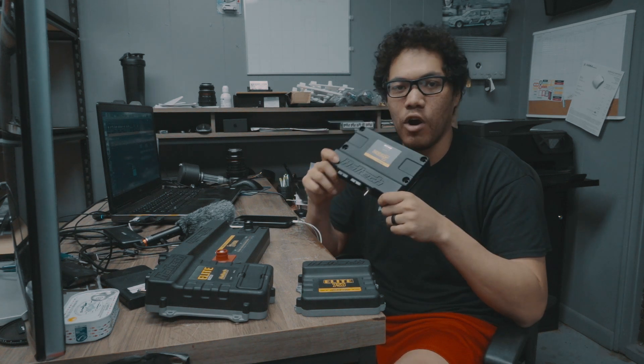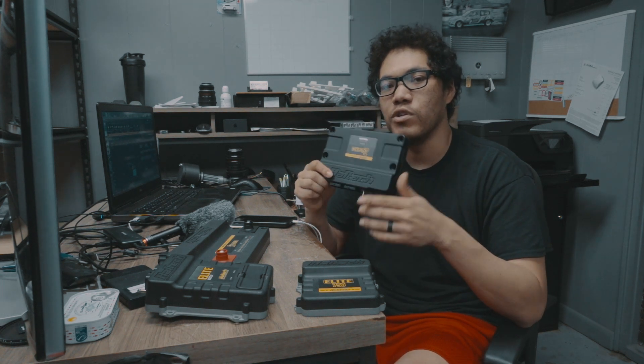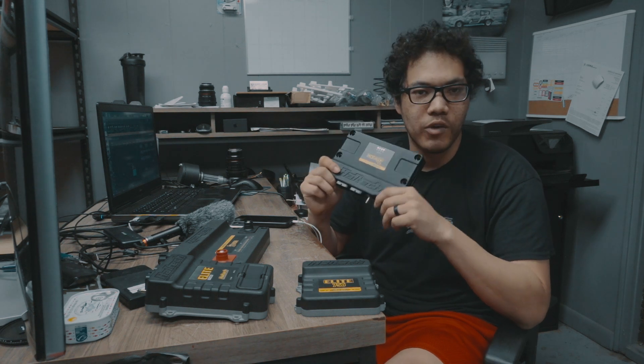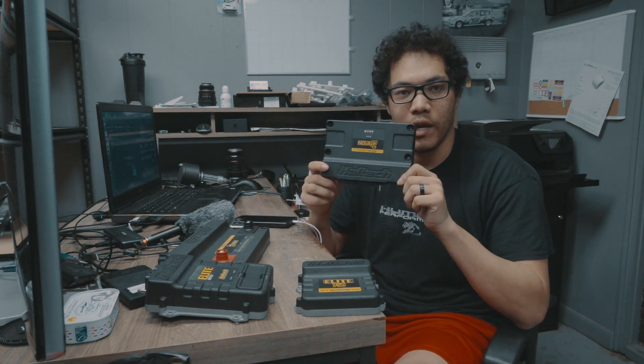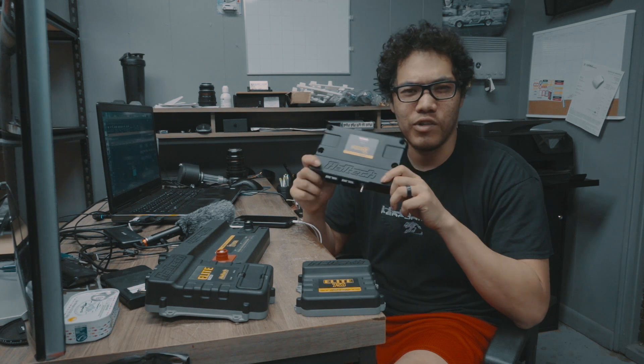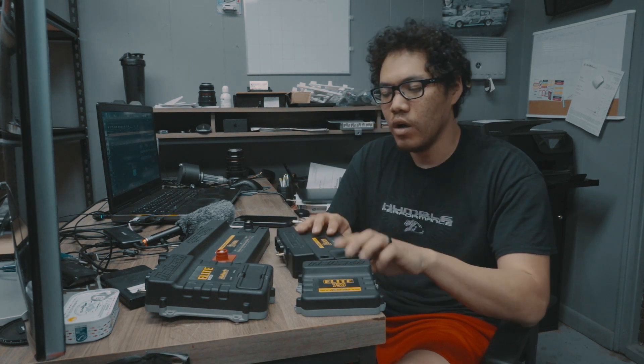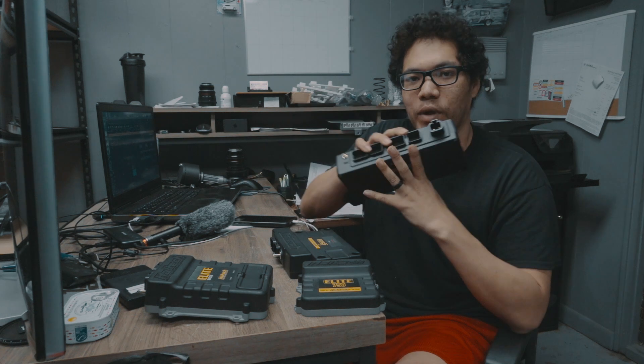With the 750 and 550, there are no plug-and-play harnesses, so you will have to construct your own harness or buy one from a third party. With the Nexus S2/S3, you can simply buy the jumper harness — which can be included with the ECU for around $300–$400 — and have it plug-and-play and ready to go.